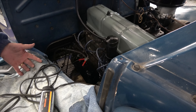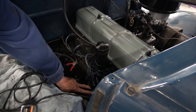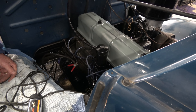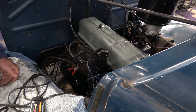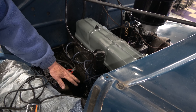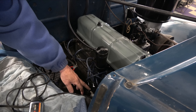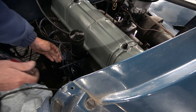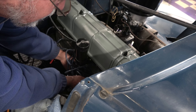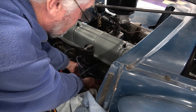Now on a modern engine, these things are so easy to do because you've got a clamp bolt that clamps the distributor in a certain place. Of course on a fuel-injected engine you don't have to worry about it. This is just with a distributor engine only. These are a little more cantankerous — to get this distributor unclamped, it's actually got a clamp on the back side of the distributor that's hard to get to. You've got to worm your screwdriver in there and find that clamp, which is not easy to do especially on a hot engine.